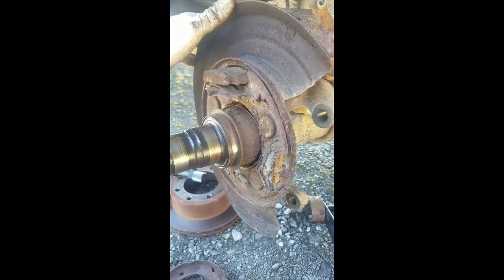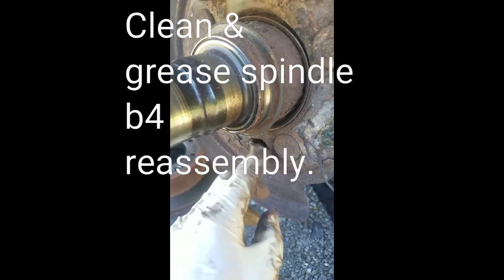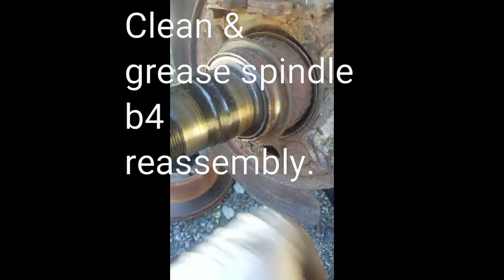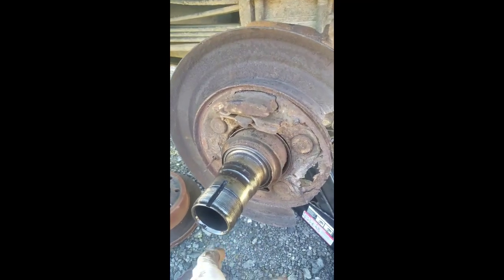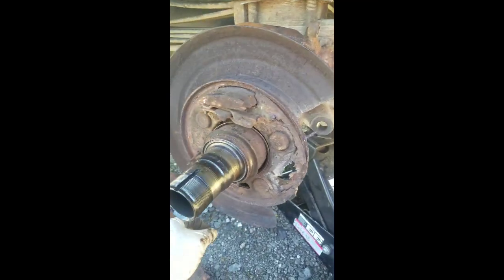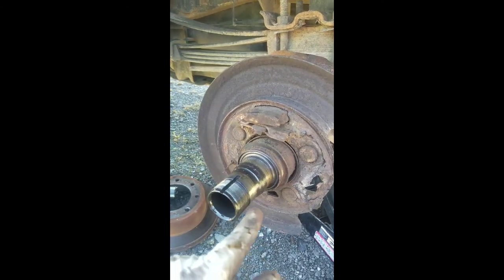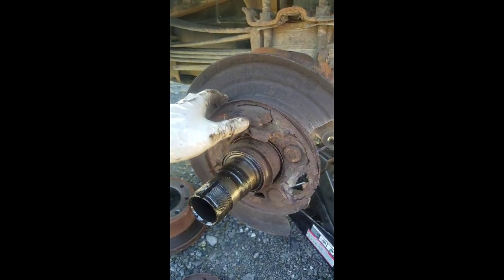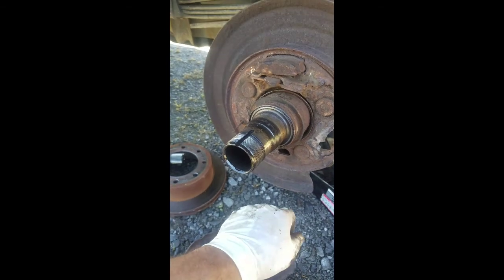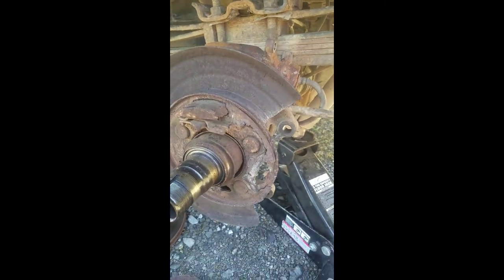Here's your four bolts — five-eighths to eleven-sixteenths, not sure exactly. This lever piece actually pulls out forward once you take the hook off. From there, I'm fairly confident you guys can handle the rest — there's not that much left. Put your stuff back together, reach in behind where your adjuster boot is, pop that old one out, and reach up in there to figure out which way to turn it to spread your adjuster. Make sure your adjusters are turning the right way — if you're not sure, take a picture of it so you know where everything goes. Put everything back together, put your wheel on, and make sure the wheel can move freely without being stopped by the adjuster, but you want it just to the point where it's starting to drag slightly. You don't want it to just flop — that means your adjusters aren't out enough and it's going to end up stretching your emergency brake cable too far. From here you guys can definitely handle the rest. Have a good day.